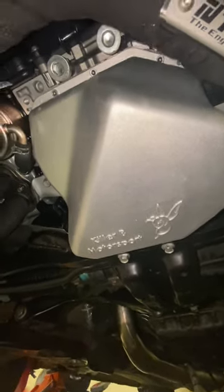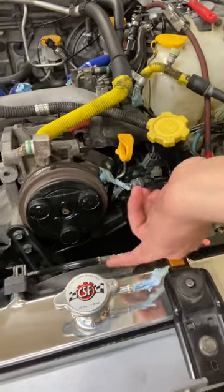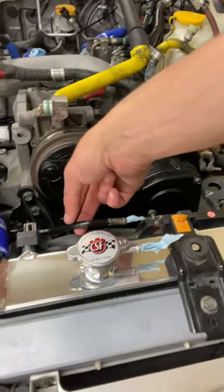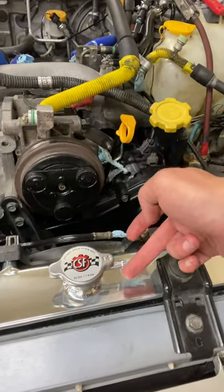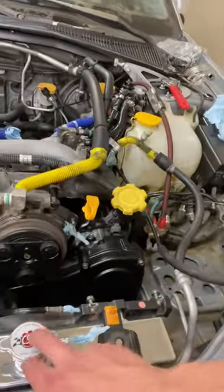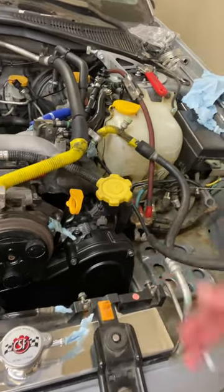Damn, she's thick. I tried to get this thing completed today but obviously there are some issues. The OEM radiator has a different kind of metal hose — one that sticks off this way and a port that sticks down this way, which goes under your reservoir and connects here. However, the aftermarket radiator did not have a cap on it — there's nothing there, but this one does. So now I have to get a T-hose or a T and a hose, combine those two, and then that'll go in.